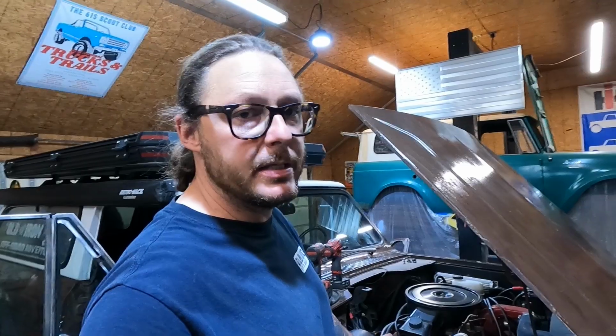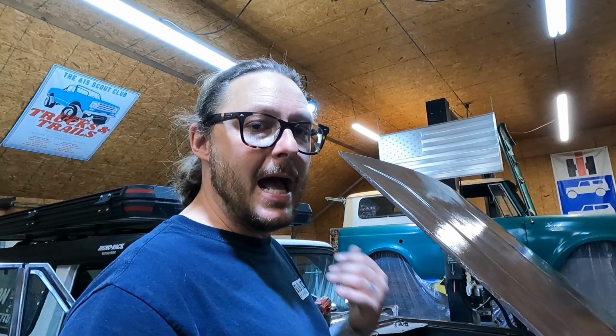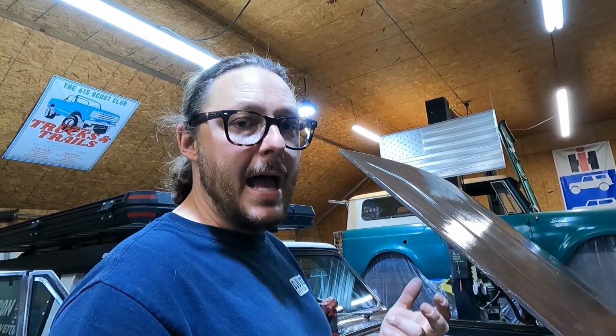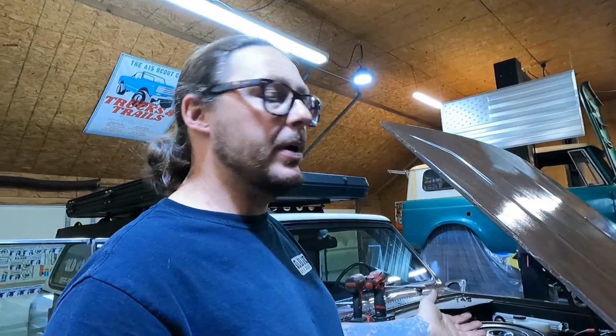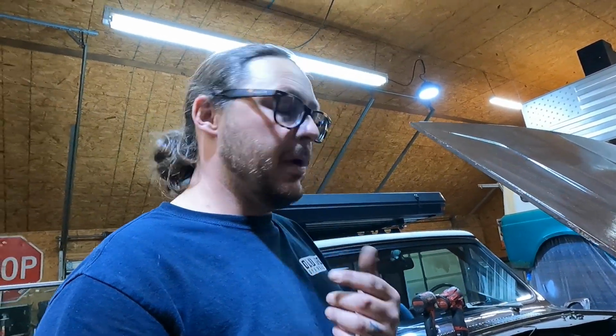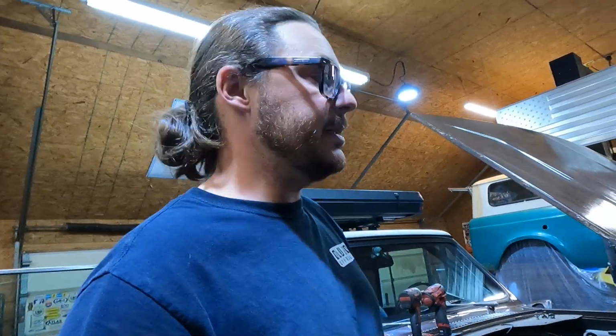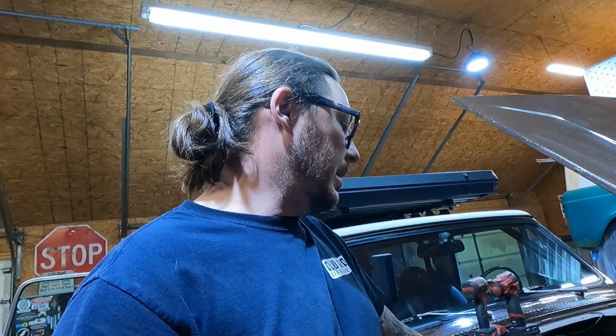Anytime you're doing aftermarket AC work or even trying to refresh the factory system, it's a really good idea to add a binary switch. What the binary switch does is it adds a high-low pressure safety to minimize the effects of any low refrigerant or high head pressure on the actual compressor itself. It acts as a kind of fuse, a safety switch, if you will. Now, if you're running electric fans, there's also a thing called a trinary switch, which, related to pressures, will actually cycle cooling fans on and off. So that's something to think about.